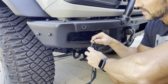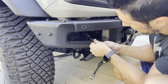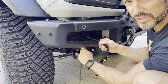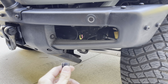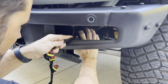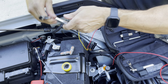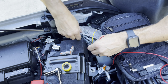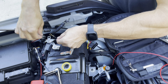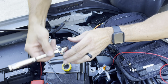I'm going to pull this tight and zip tie it to the crash bars just to hold it in place. It can't be seen, it's not too exposed to the elements, and I think it'll hold up pretty nice. I'm going to connect this adapter — make it a little bit easier after I get the lights installed — then pull it back and zip tie it to the frame. There are a couple holes, so I'll zip tie that together and do the same thing on the other side. Then I'll come over to the battery, loosen it, and connect the black ground wire over here, then tighten it back.